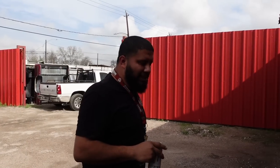All right, guys. So we just made it to North Jensen because we do need some parts for a truck that we have here. I don't know if the guy watches the videos, but that real clean white GMC or Chevy, crew cab, it's at my boy Mauricio's. He's fixing the frame on it right now because whoever took it back down to stock height after removing the lift, they didn't put the cross member, and the guy didn't know. He was driving around, started noticing, started getting camber.